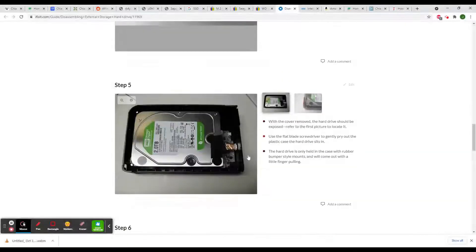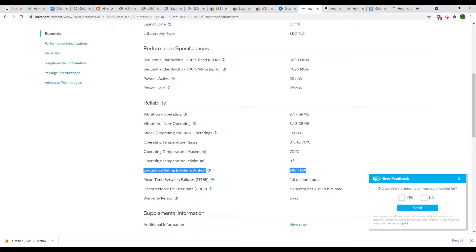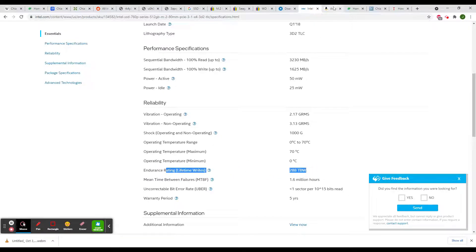Sometimes it is a cheaper way to get an internal hard disk. And I will remind again: for creating plots you need a fast SSD disk with M.2 or other PCIe fast interface. When selecting an SSD disk, you should check the endurance rating or lifetime write specification — the higher number is the better specification. Because during mining, data is being written and erased to your SSD all the time, so during a short time it will wear out. You should check this specification — it is very important.